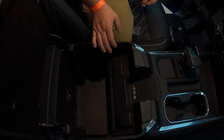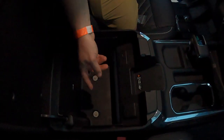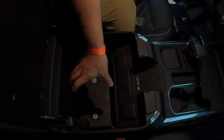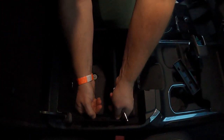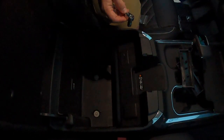I took the liberty of cleaning out the contents of the center console. First things first, most have a rubber mat — pull it out, exposing the two factory 10mm bolts. Set that aside. In order to drop the safe in, these tabs — their basket or tray — just pull out and lift up, they come out. Now everything's clear. You can remove the bolts with a hand tool since there's plenty of space, or an electric drill — today we're doing it the old school way.